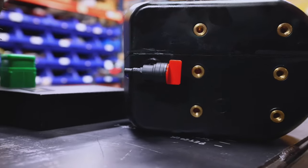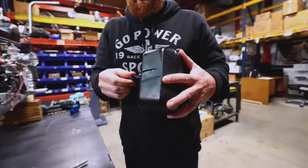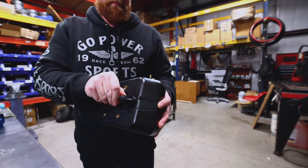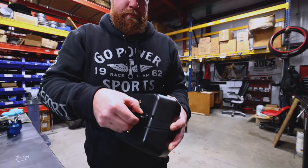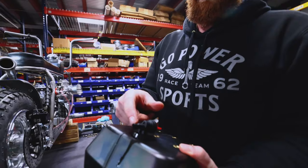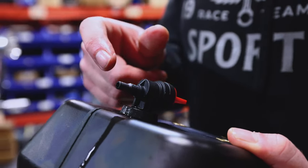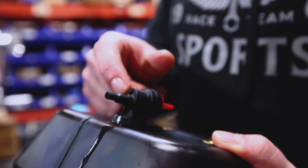And there you have it — this is the petcock installed in the unit tank. On and off. As you can see, that is not coming out of there. This is a three-sixteenths barb. If you're using quarter inch line, you can cut that off and use quarter inch line on this barb.